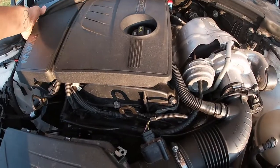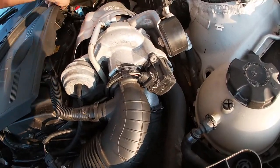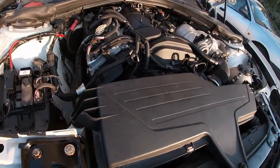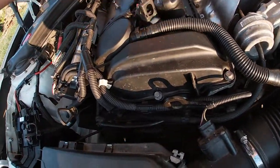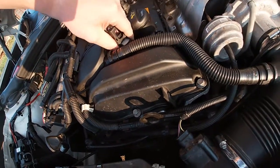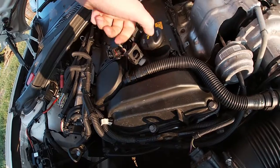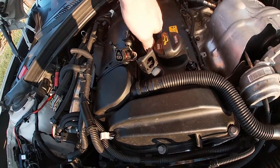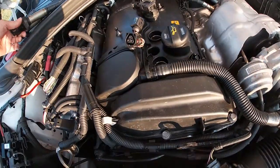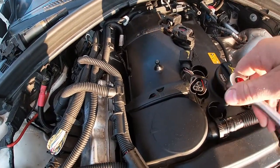Changing plugs in this car shouldn't really be too hard. We'll need to remove this cover — since it's pretty hot I'll move it completely, though you could just flip it over. After that we need to remove the ignition coils. One ignition coil doesn't want to come out, but we remove them all and then hopefully undo the plugs.